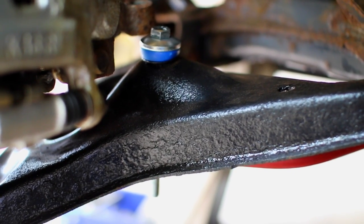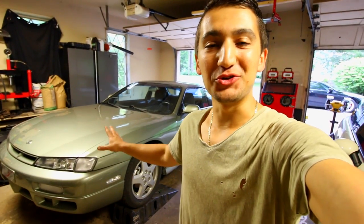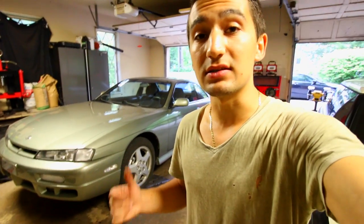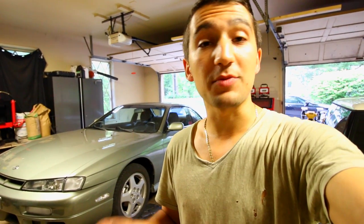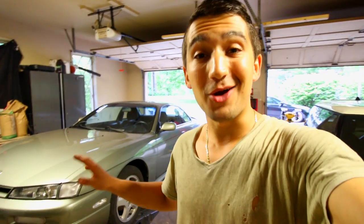Once you do this to both sides of the car, put the wheel back on and take the car for a drive. I just took the 240 out for a rip and oh my gosh did it handle completely different. Right now it still has 16-inch wheels with a very tall profile tire — I want to upgrade to 17s, run a lower profile tire, and maybe go a little wider since these are 205s right now. There's still a little body roll because the sidewall is so soft, but the chassis itself is not really moving that much. With the upgraded front sway bar and now the upgraded rear sway bar, the car is pretty dialed in.